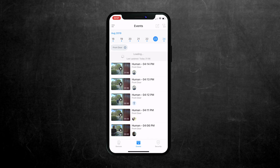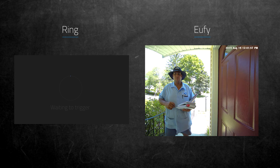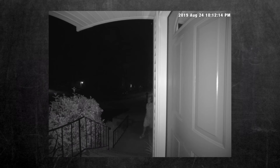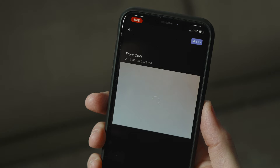The doorbell in practice has been amazing so far. It's only missed a couple of recordings compared to my Ring missing dozens during that same testing period, and false alarms have been non-existent. The doorbell appears to record a non-stop video stream into a buffer because it captures 3 seconds of video before the actual triggered moment. On my Ring, there are countless recordings of someone's back as they're leaving the front door. With that 3-second buffer on the Eufy, we're getting better recordings of people walking up the walkway. The night vision mode works just as well as you'd expect. Notifications are timely — a doorbell press triggers a notification within half a second to one second on my phone, and the wireless chime goes off instantly. The only delays I've noticed are when using the push-to-talk feature.